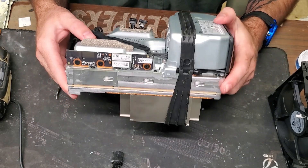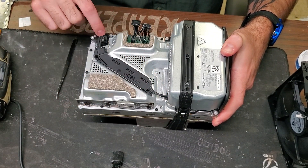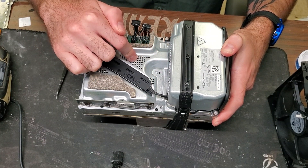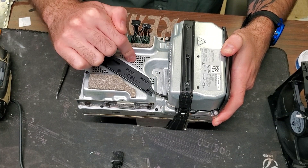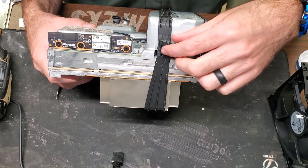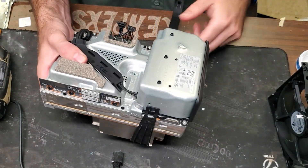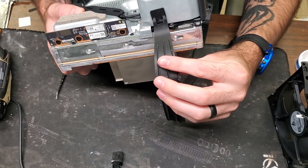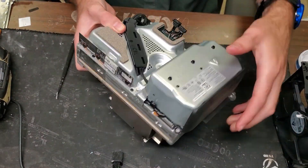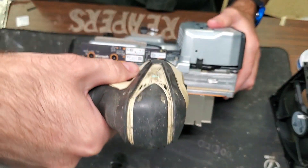We need to gain access to the power supply. It goes over the top right here — this is where you actually plug it in, and where it's plugged into the motherboard is underneath this aluminum plate right here. We need to get access to that. First thing we want to do is take off this rubber piece, which doesn't really do anything but it's there. Then we need to take the screws out — there are three on there.